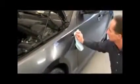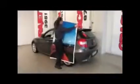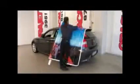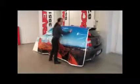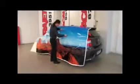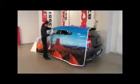Any potential residual humidity, especially underneath rubber seals, has to be removed with compressed air and the surfaces allowed to dry. After aligning the vinyl with released liner still in place and placing it on the car, and after feeling for the vehicle contours, the vinyl is now roughly cut to shape. When doing this, the vinyl should be held away from the vehicle to avoid damage to the paint surface.